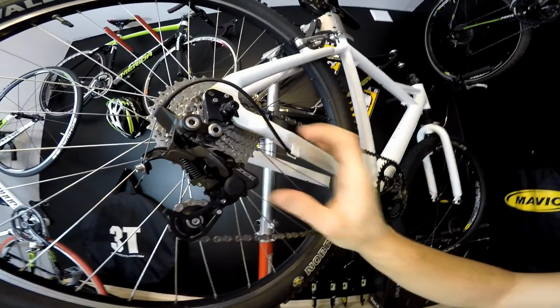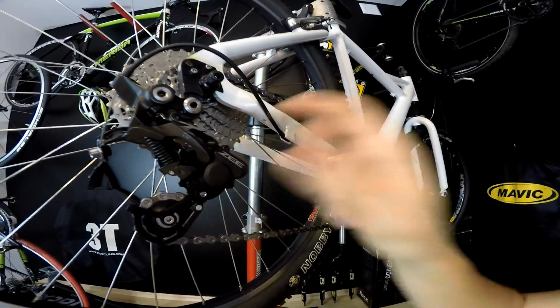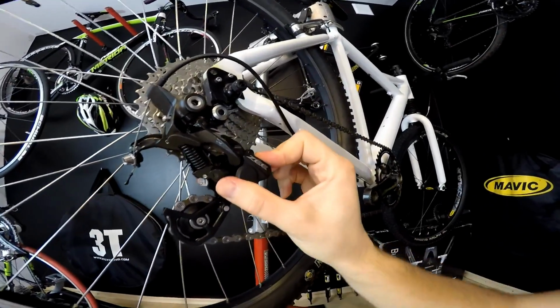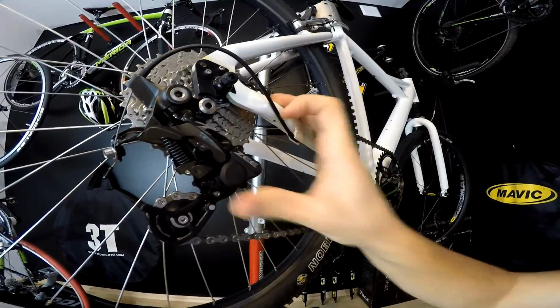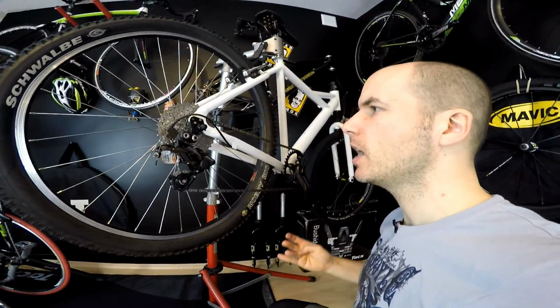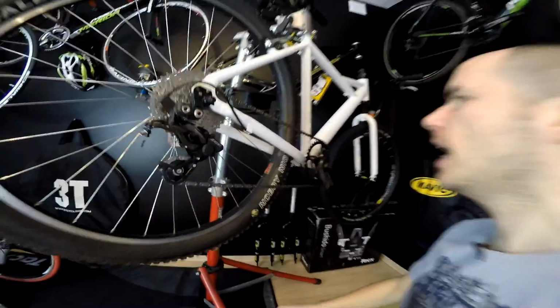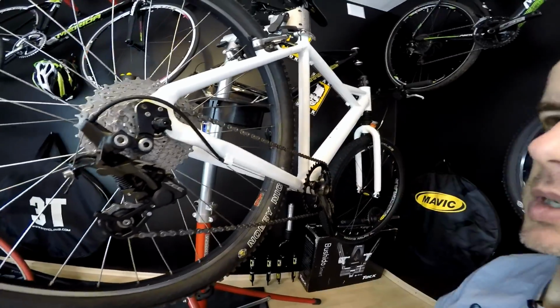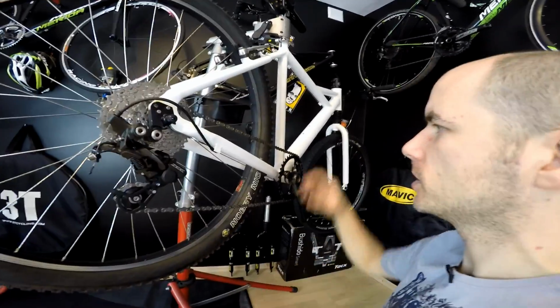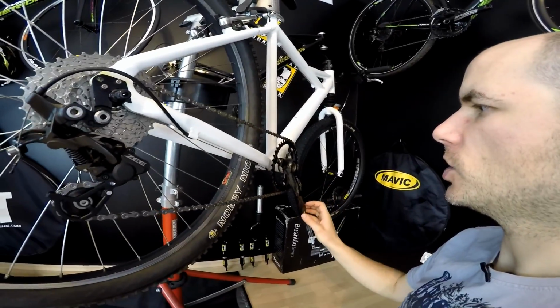When it comes to the derailleur, it has this clutch here, and when it's in the on position, it really prevents the chain from jumping up and down. So I don't feel like any chain guide would be needed. Maybe for some hard racing, when I really want to be sure that the bike is fully prepared for it, I would put on a carbon chain guide weighing maybe 10 or 15 grams, but I didn't experience any chain drops, and it doesn't seem like I will.